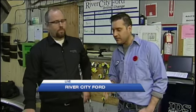Our car is plugged in and nice and toasty. And just quickly before we wrap things up — when we're thinking about running our cars and warming them up before we go, is there a rule for the upper limit on that? How long we should be running them? I really wouldn't let it run longer than five to ten minutes just to get you going. It's a preference too for the driver whether or not they want a nice warm car. But as far as the engine, it doesn't need much more than that.